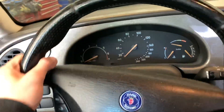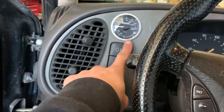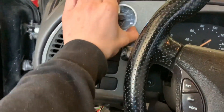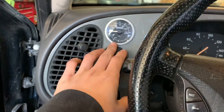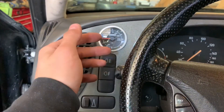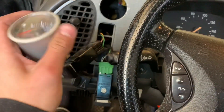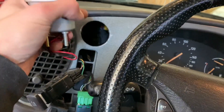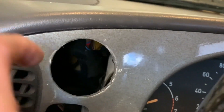Please use safety glasses while Dremeling — I didn't do that and I got a bunch of debris in my eye, so just vacuum that up after. That is what you want. I just found out you don't even have to use silicone to keep this in — if you get a nice tight cut and check it every couple passes, it sits in extremely tight and you're not getting it out anytime soon. When you put it in, make sure it's straight and where you want it. Don't worry too much about blemishes on the side — clean it up with a file if you'd like, but the rim will cover that.